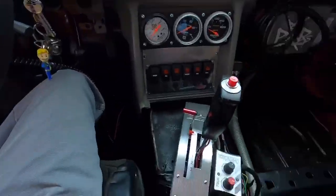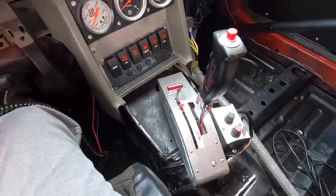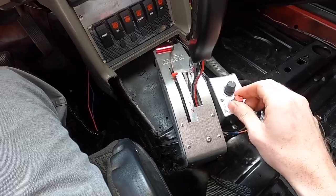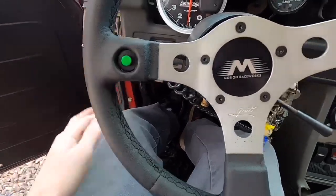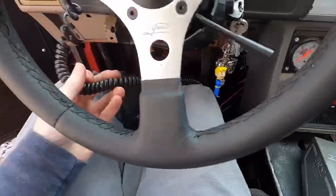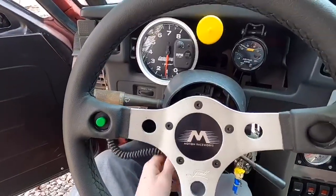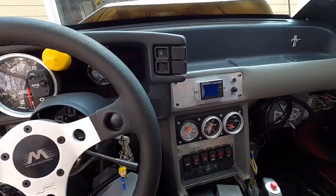I figured it out — turns out there wasn't anything wrong at all. I was playing with some settings and it turns out I'm going to have to crank up the aggressiveness. My particular trans brake solenoid, and every trans brake solenoid acts a little differently, just needs quite a bit more aggressive adjustment. It was working fine the whole time. The other thing I think I was doing was clicking it too fast — you've got to click and hold for a second. So now all I need to do is get this cable tied up with enough slack so it doesn't get caught in the wheel. Everything works, so good news — we're ready for our first track outing. Thanks for watching, subscribe if you like this content, and I'll see you in the next one.